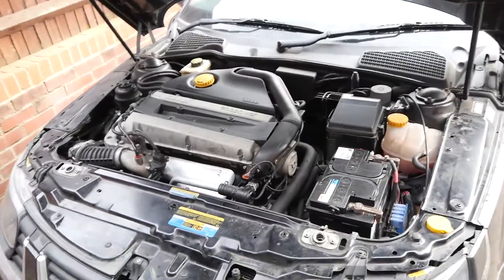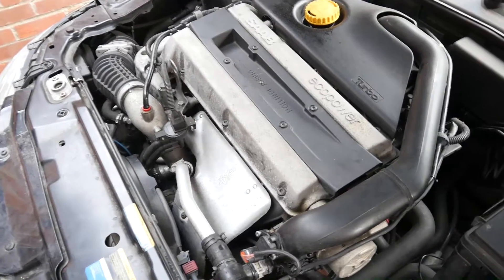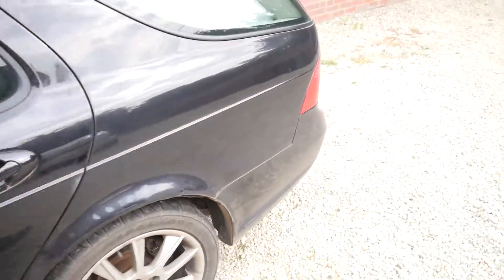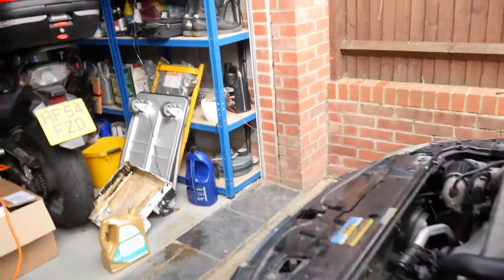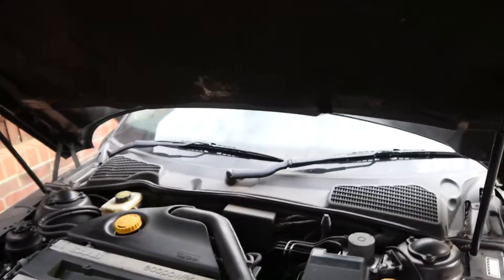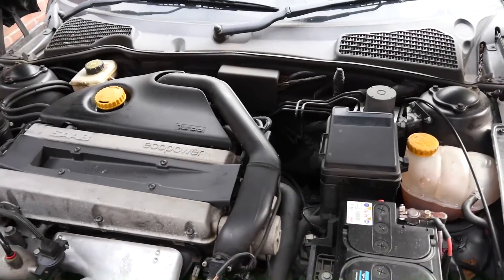After a little while you'll notice that the smoke around the turbo disappears — that's old engine oil coating certain surfaces and the lacquer on the turbo burning off. Moving around to the back, you'll notice the exhaust tailpipe has cleared up a lot. Depending on how much oil has ended up in your tailpipe that may take a while. Keep monitoring the inside of your car, the oil pressure, and the temperatures of your various fluids as you drive it for the next 500 miles. After 500 miles, change the oil — it's recommended — and then you're good as gold.